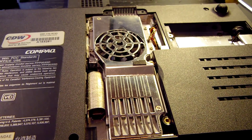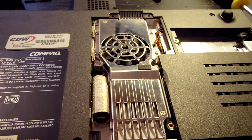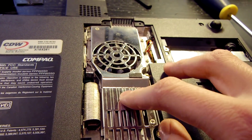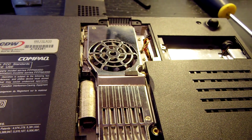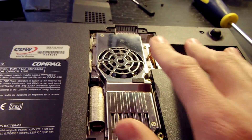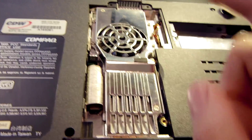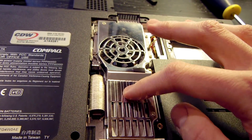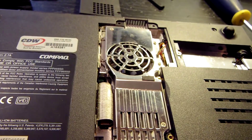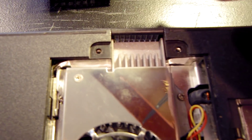In the comments of my overview, someone said the RAM would be under the heatsink and someone else said under the keyboard — congratulations, you were both right. The removable stick was under the heatsink and the permanently mounted RAM was under the shielding below the keyboard. Now, looking at the heatsink design: there are two air intakes — one blows over the RAM to cool it, and the other pulls in cool air for the CPU and exhausts out the back.